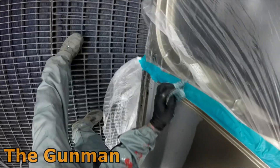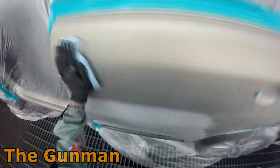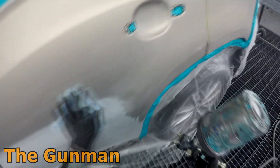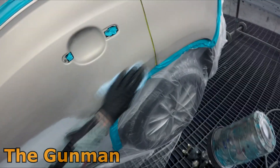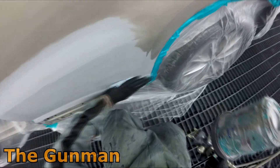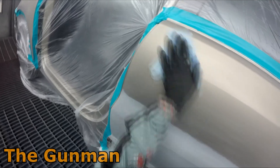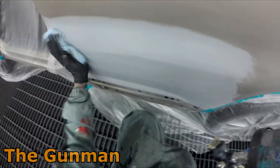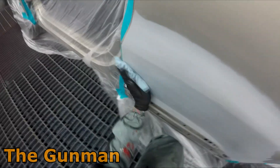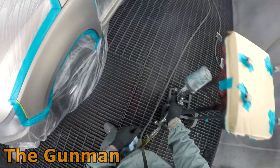I'm actually using PrepSol. There are some different water-based cleaners on the market, but the other two painters here say all you need is PrepSol - a wax and grease remover. You can use those specific water-based cleaners, but on the door if you're going to be putting wet-on-wet, I would not be recommending using those water-based cleaners because it's a solvent-based two-pack wet-on-wet prime going over there.